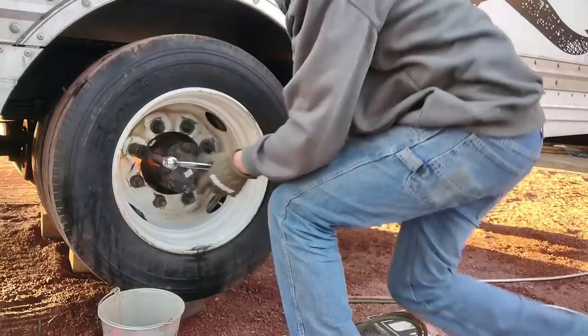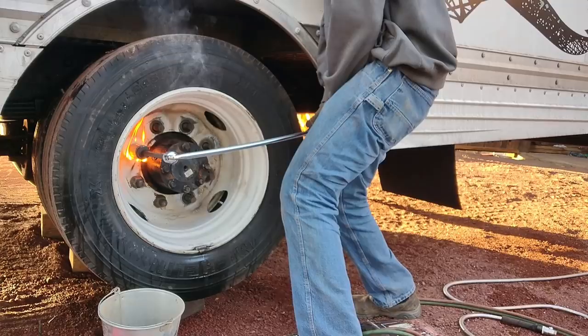So this is where it all went wrong. By this point, I had already tried using my normal electric impact guns with no luck, switched to my one-inch drive air impact that I use for all my big semi trucks and hammered on these lugs for so long that I broke my one-inch drive impact socket, then switched to my three-quarter drive set and a big six-foot cheater pipe on a breaker bar and snapped my three-quarter drive impact extension. So I had to resort to heating them up, glowing red with the torch, and then prying them off with a big breaker bar.